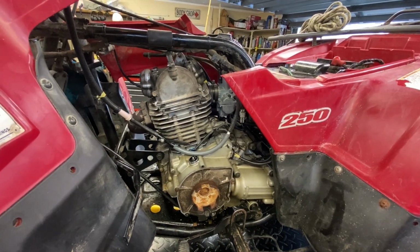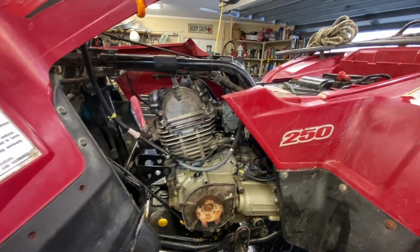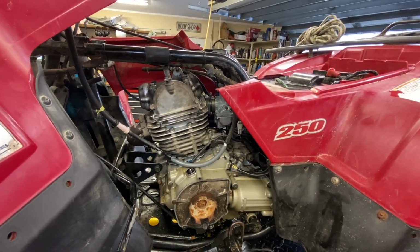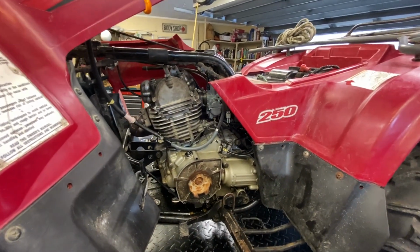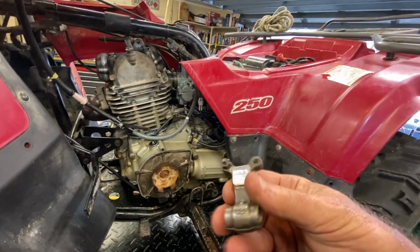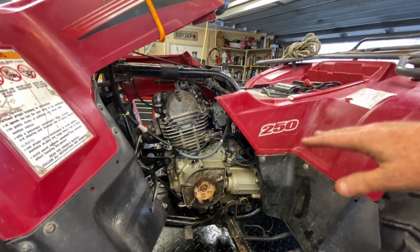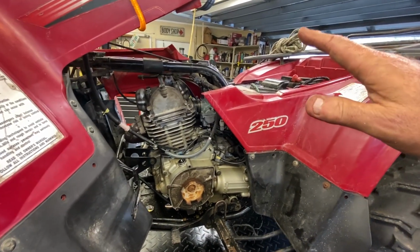And I ground it and filed it and sanded it and got the profile right, and said, you know what, I think that's going to be better than this Chinese crap, because whenever I weld something and then I have to drill something afterwards, I end up burning up high-speed steel on that. So I know the weld is hard. Probably not necessarily as hard as these, because generally these are case hardened. But you know what? Like I said, it's not going to the moon. It's not for NASA. It's just for a kid to run around for a year or two. I guarantee it's going to last that long.